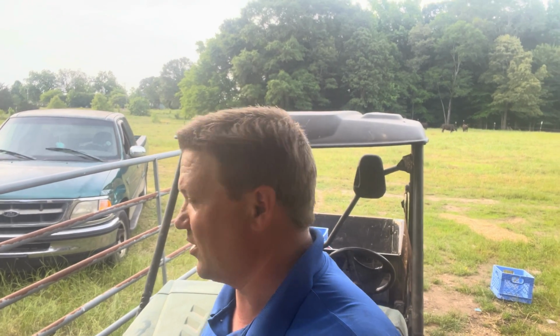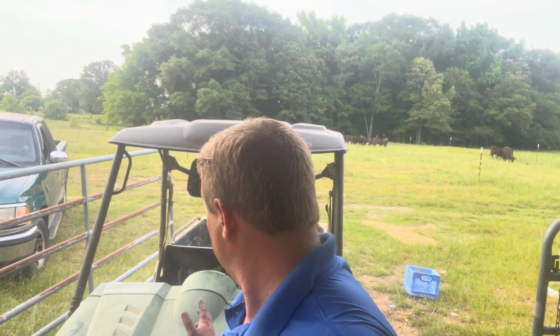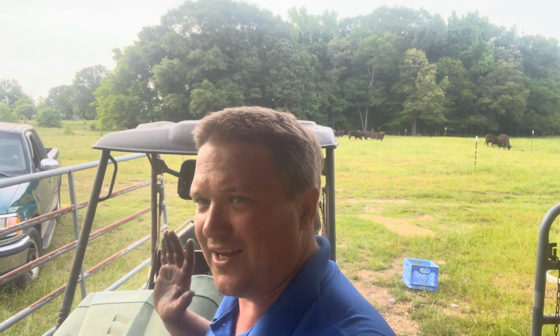Woo! The test drive in the Rhino went fine. It actually drove 44 miles an hour before the governor kicked it off. It was doing it at 35, and a year or two ago it was doing it at 39 or 40. So the new belt certainly is worth it, and then the clutch is working too. It did not do that driving and then stalling, which I think was the wet clutch issue.